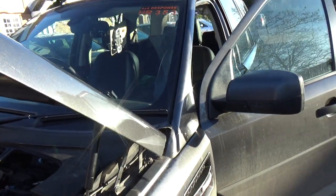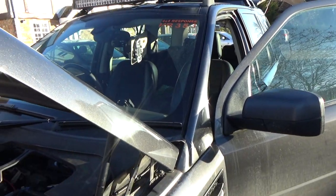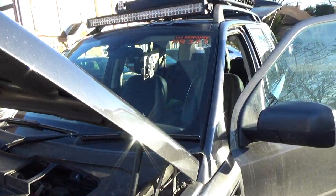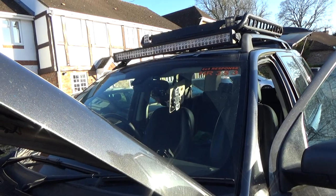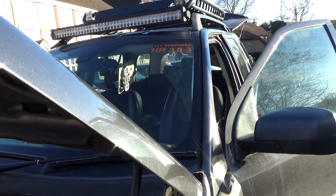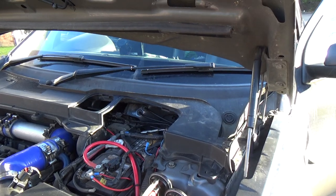The lighting regulations clearly state that the light bar or any other spotlights do need to turn off when you dip your lights, but there's no requirement for an enabler switch. The reason I'm having one is for occasions like snow or mist where the light bar creates too much glare back from the screen. It also helps if you get an MOT tester or a policeman who questions it — having a separate switch avoids any awkward conversations.